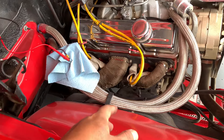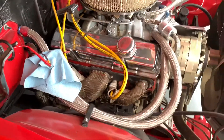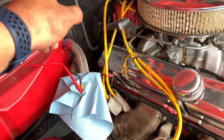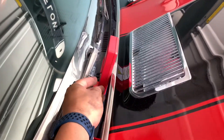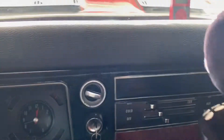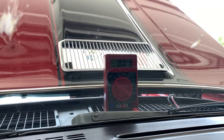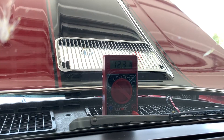What I'm thinking is going to be the solution is to put a relay inline with the starter. On the starter you have the power wire and the signal wire from the ignition — that's the one dropping to six volts and not engaging the starter. I wanted to make sure that without the starter connected, that wire gets 12 volts, so I removed that wire, hooked up my multimeter positive lead to it and the negative to a bolt, set it on the hood so I can read it through the windshield as I try to turn the key. When I turned it, we got 12.37 volts — enough to trigger the relay.